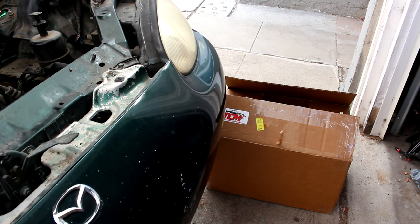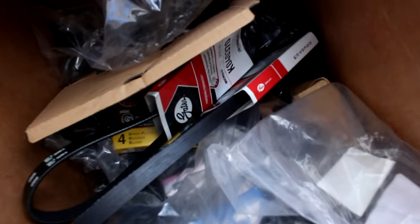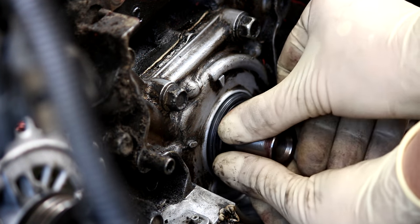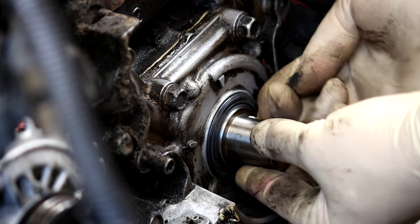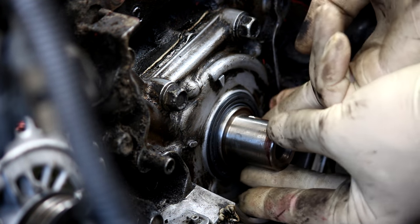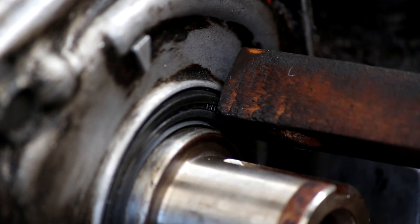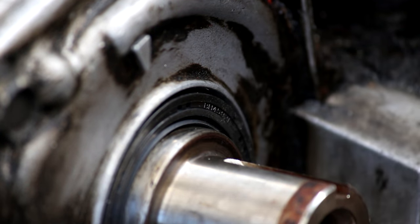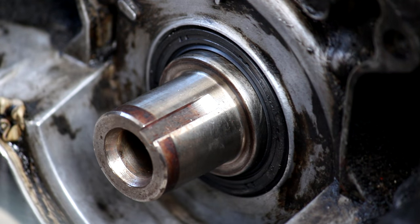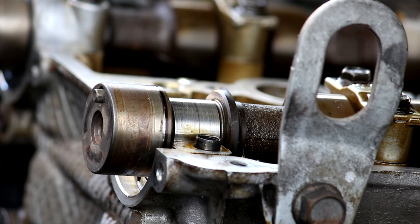If you've made it this far, congratulations — we're officially at the halfway mark, and it's time to start bolting on all of this brand new stuff. The car is going to run so nice and smooth when all this is finished. I've got to make sure this thing's in tip-top shape because we're getting it ready for nitrous, making big power, and it's going to be fun. I'll start by installing the front crankshaft seal. Sometimes it can press in all the way by hand; sometimes it's more stubborn. The biggest thing is you don't want to push it in too far because it's hard to pull it back out without damaging it. Get it almost all the way in by hand, then take a flat handle like a piece of wood and tap it in — it won't go too far as long as you let it overhang the oil pump, which acts as a stopper.